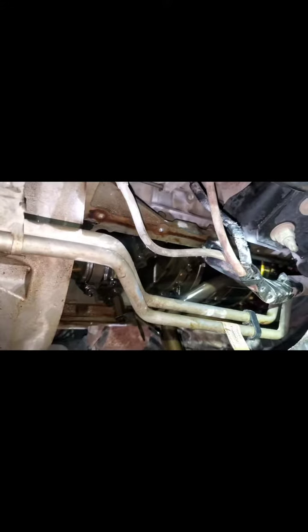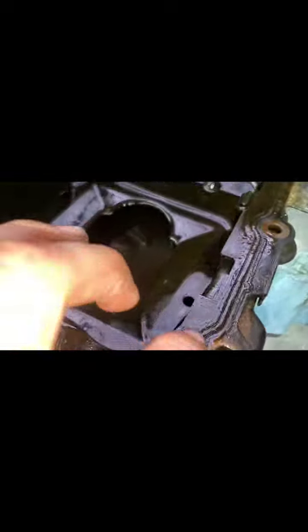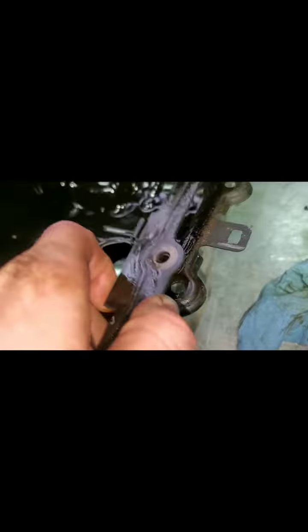The oil pan actually did not leak when it was running. We had to let it sit overnight, and then I came back and there was actually oil around the pan. The pan gasket became extremely hard — it only has 150,000 miles but it is completely hardened.